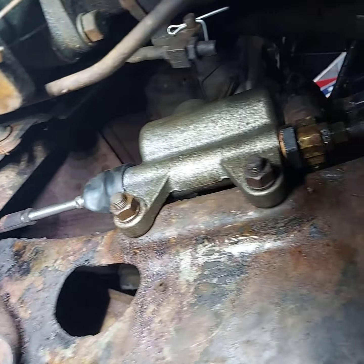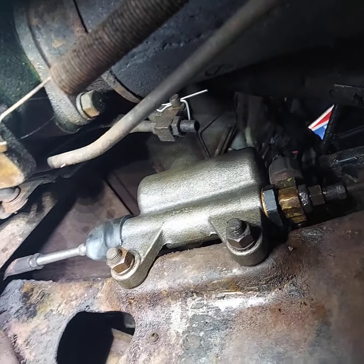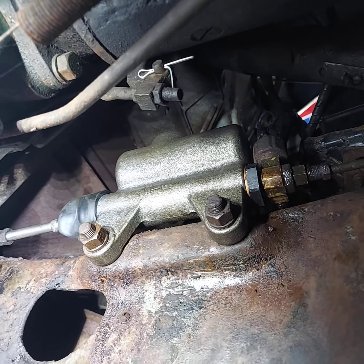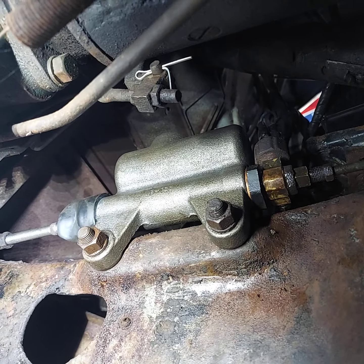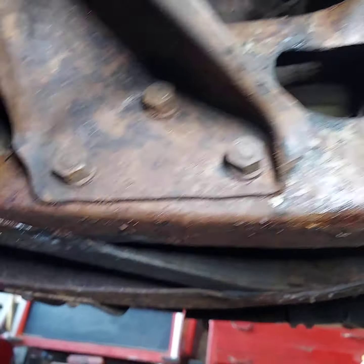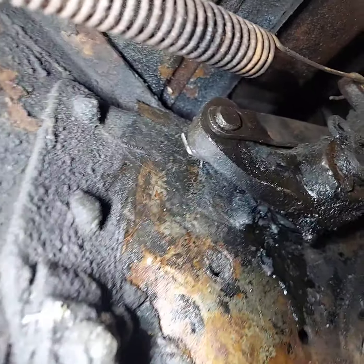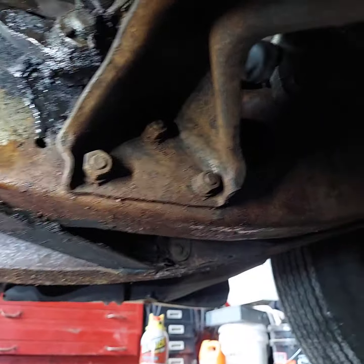And I guess the fluid that goes in there is probably, since this car's so daggum old, probably Fred Flintstone brake fluid. It's not shoe soled, but some sort of fluid. I suppose DOT 3 will work. Anyway, we got it adjusted and got the clevis back on there, and got it pinned and cotter pinned, and should be ready to go.